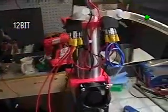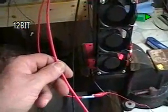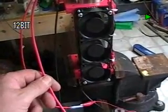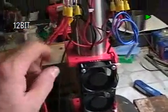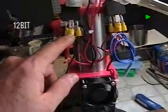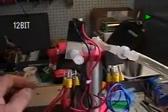Now we'll step back a little bit so you can get the whole picture. Here's your blue wire that goes off to your pump. Here is your thin red wire — that's what goes to your power switch on the ACC accessory. And here is your heavier red wire, which goes over to your fuse, from your battery to your fuse block, and then it ties directly into the power side of your power relay. That's the circuit that actually makes the HHO generation, turned on by that relay and controlled by the thin power switch wire which energizes that relay.